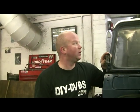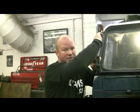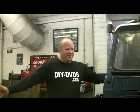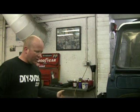That's it. That wasn't hard at all. What I'll do is use a lever to just make a gap up the top so we can run some sealing in all the way round, and then re-silicone it. That was too easy — I can't understand it. Well easy. So now I've done that, I've knocked that over and I'll go and get the hinges bolted in. And it's starting to look like a Land Rover again.